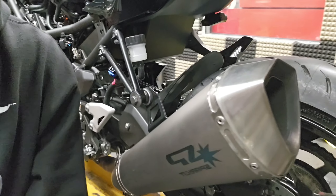We are back on the dyno today with our Ninja 500, and this time we have a full Spark exhaust without a baffle in the muffler, and it performed pretty much exactly how I expected — which is not great. We had the full M4 with the baffle in on this bike previously with the TST velocity stacks and DNA air filter, and we had that mapping already flashed into the ECU. When we put on the full Spark system and did a couple quick baselines, I was both shocked at the air-fuel ratios I was seeing and, at the same time, not really that surprised.